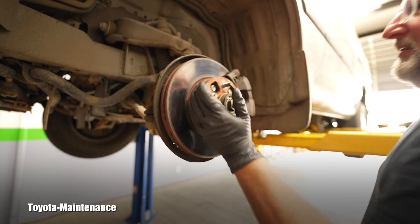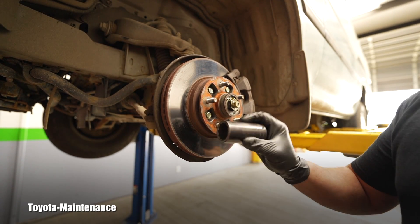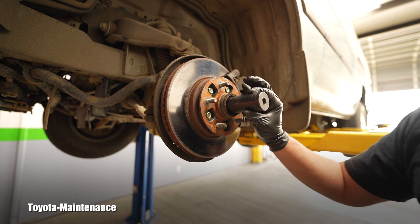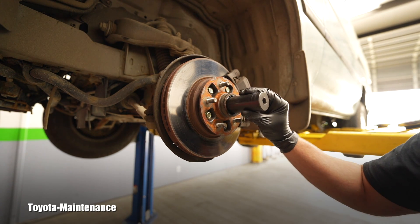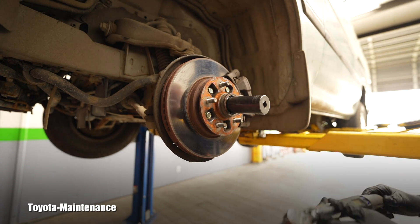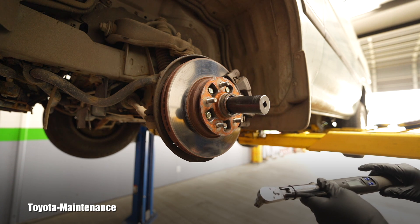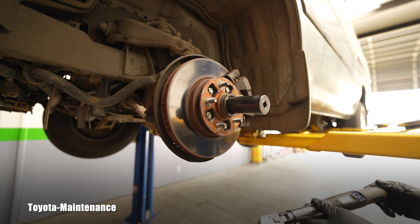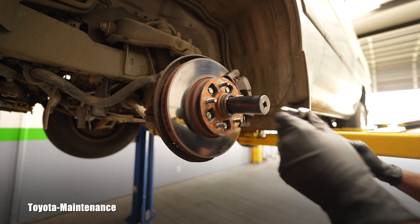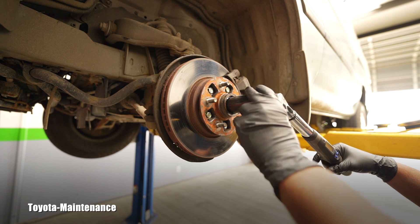That's the standard in the USA, but we are working on a Japanese vehicle. The socket will be 30 millimeters. So 21 foot-pounds converts to approximately 28.5, so I'll say 29 newton meters. I have here a 30 millimeter Snap-on deep socket, and I grab my torque wrench and set it to 29 newton meters. I can see it here — 28, 29.